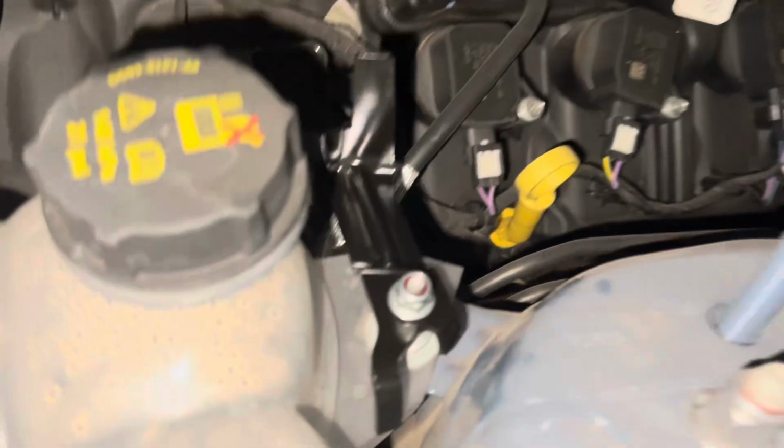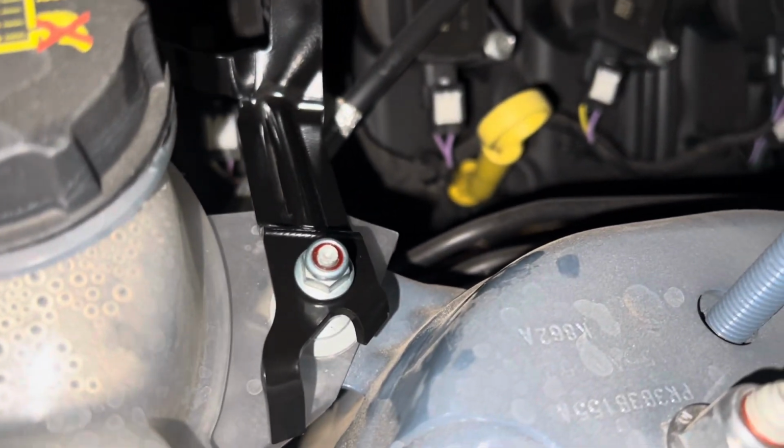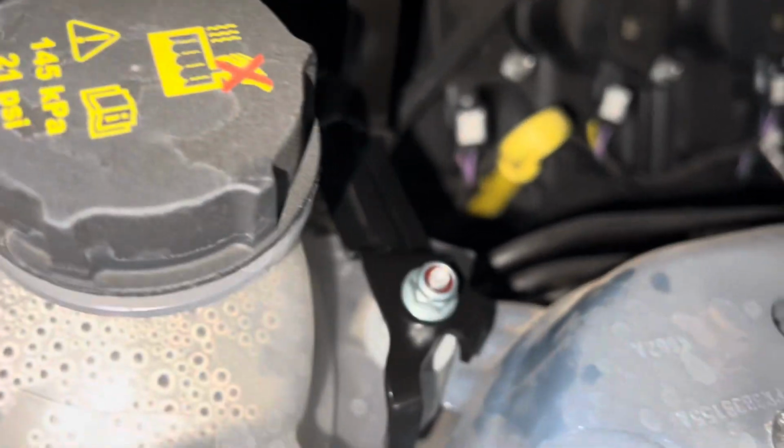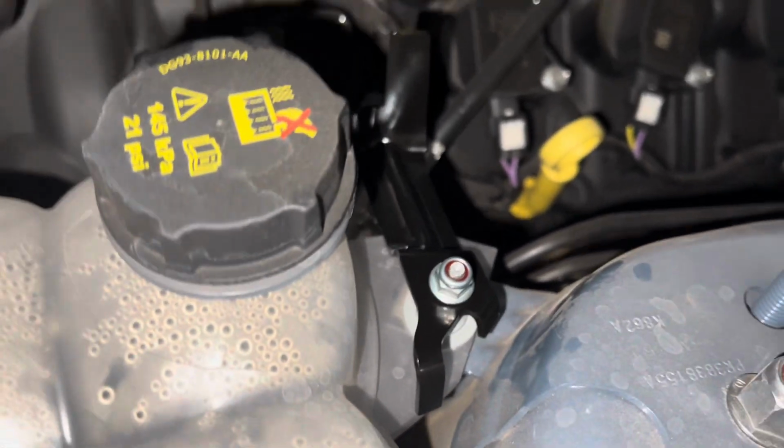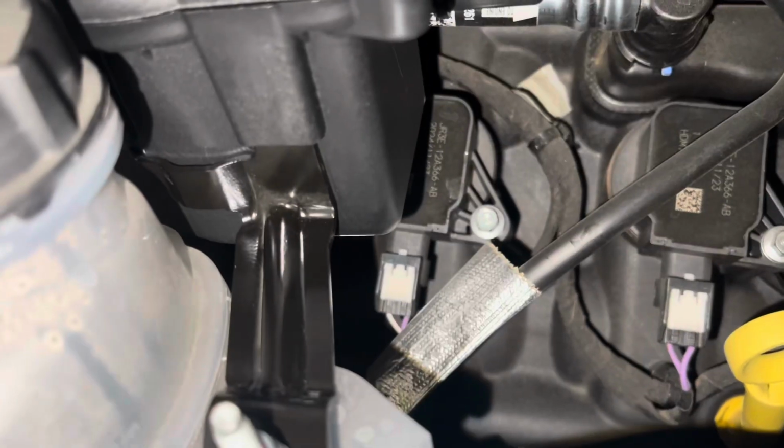Okay, correction, do not remove the stud bolt because it is a stud bolt. So leave it in and you put the bracket over the stud bolt and then put the lock nut on top, 88-inch pounds mount. Okay, so we have the can test fit. May try to get it down a little bit lower, but it's pretty much set in there.